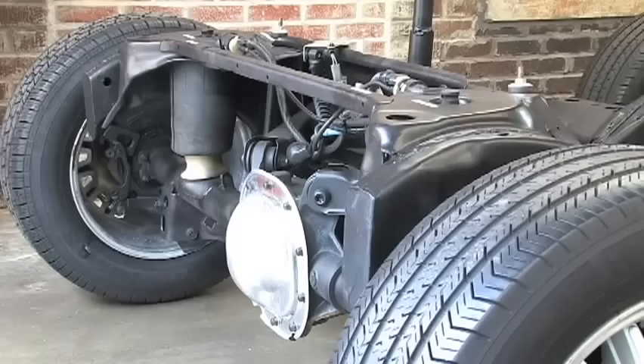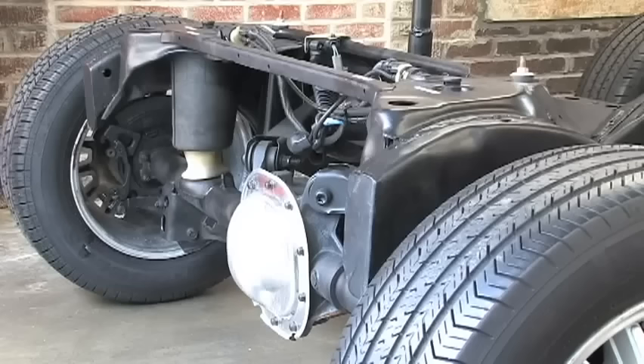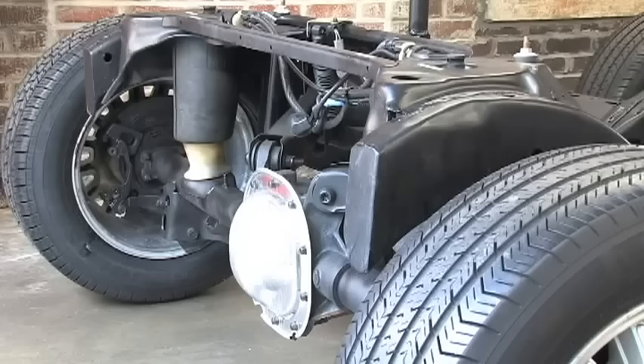Now Chris will add air into the system. We accomplished this by energizing the compressor and pumping air through the dryer. Your car has tubing attached to the compressor that runs to the solenoid valves. The onboard computer opens the appropriate solenoid valve and allows air into the air spring. Now the car is again level and safe to drive.